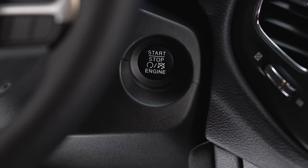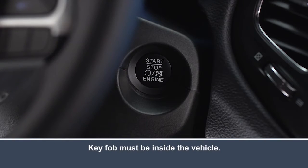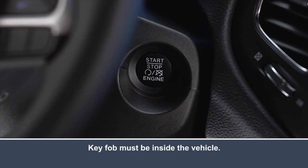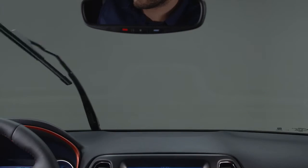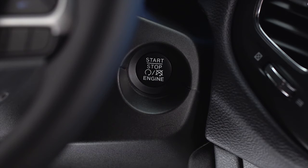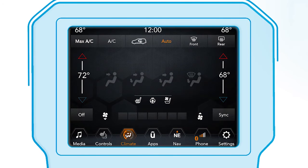To use accessories without starting the vehicle, don't depress the brake pedal. Instead, just push the engine start/stop button once to enter the accessories or ACC position. From there, you can activate the radio, wipers, and windows. Push the button a second time to enter the on-run position, so you can activate the instrument cluster and certain climate controls.